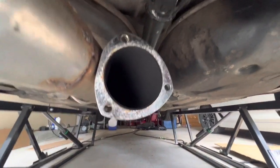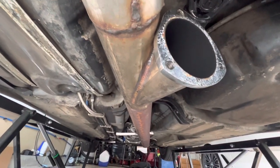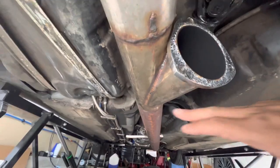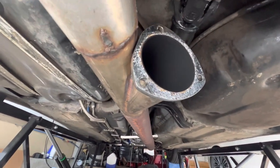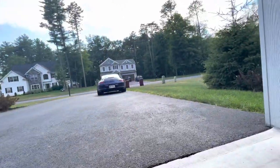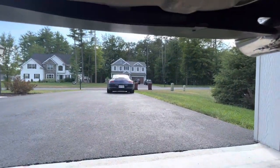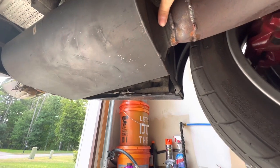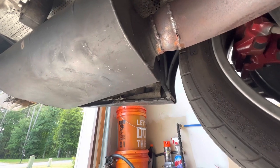To prepare myself for this, when I built the Turbo LS Swap, I welded this cutout on already. It came with a whole Y — all you had to do was weld here and weld there, and it came all together. I did this because I live in a residential neighborhood and I don't want to be coming home at night really loud with people getting pissed off. So we had a muffler, but the problem is it's only three inches, so this is really where my exhaust restriction is, and it was killing my boost.